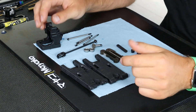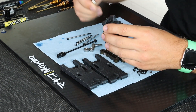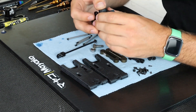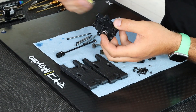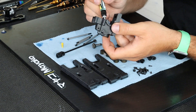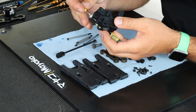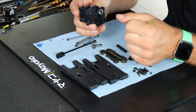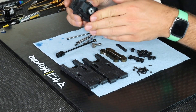Same thing here — I started the same way on the front end. So I'm just going to remove that bit of extra plastic, add the bearings inside the gearbox for the pinion gear, then add some bearing oil to the bearings. These bearings last for a very, very long time — I don't think I have replaced them that often this year. Really good quality bearings in the kit for the pinion gear.